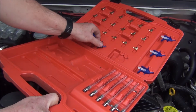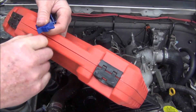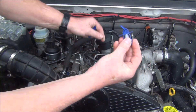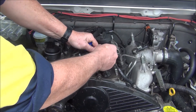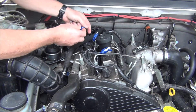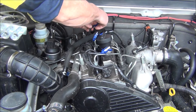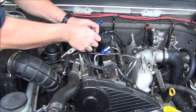You'll need four of these just to block off the return lines. On the return lines, I usually hook these on just to stop a bit of air going back in the line, which you don't want in a diesel motor. So you just plug it — it's just a plug so no air will get in. Just put them all in.